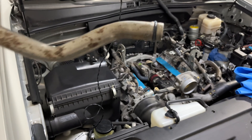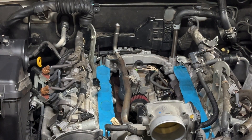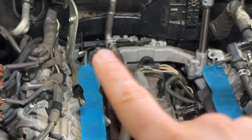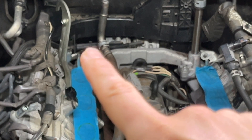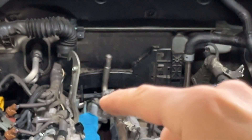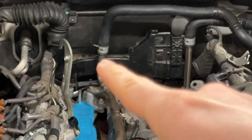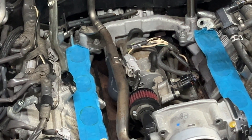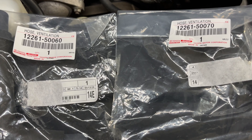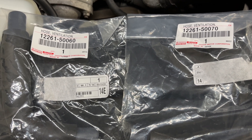The pipe is installed and secured. I also made sure the air lines to those valves are secured in a little bracket, and now we're going to hook up the coolant pipe — coolant pipe is on and connected. Don't forget to secure the wiring harness to the little bracket on the pipe.